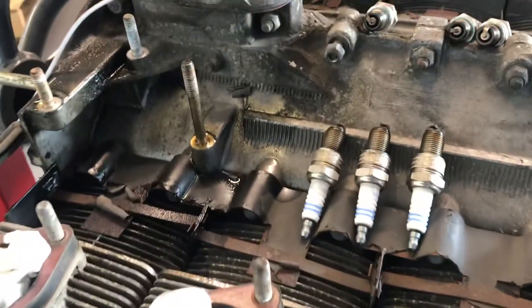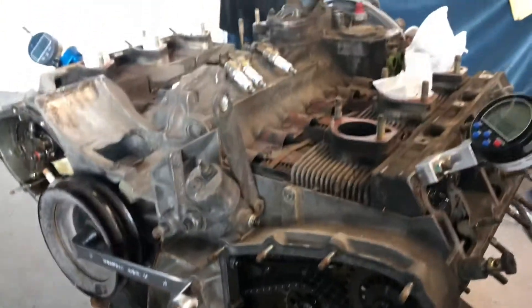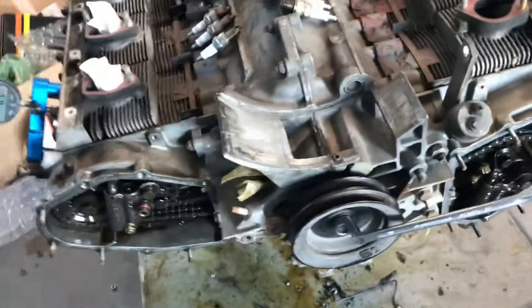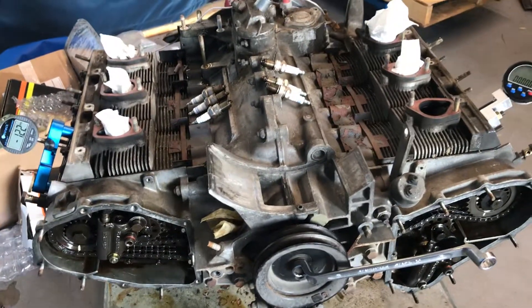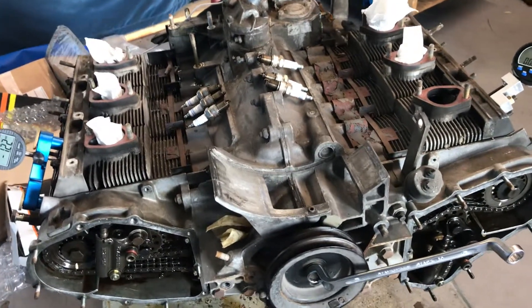But the intake isn't horrible — you'd expect it to be a little worse. It's definitely a 3.2 AC, and there's a little engine number right there. Looks like it says 930 21. So we'll check all that stuff out. Pretty neat to see a relatively unmolested engine and see how they had the timing set — 1.2 millimeters at TDC. Interesting. Check us out at Brightworks.com.